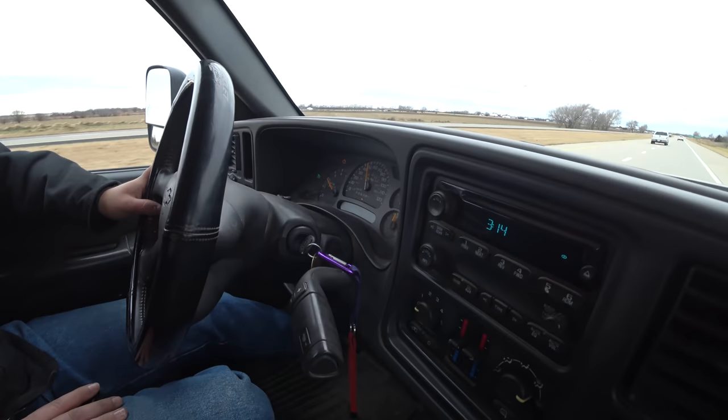So the limo weighs a lot, I think we all know that, but it weighs a lot on the back axle. And of course, with how long the limo is, we had to load it with the rear axle all the way back on the dovetail, and then we just boomed it on there. You can tell the rear axle is about 2 foot in front of the rear of the trailer. So with how much weight we've got off the back of the truck, it just waves anytime you're above 50. So we are pulling this thing like an hour, hour and a half, and it's just in cruise control at 50.